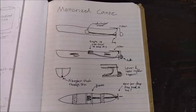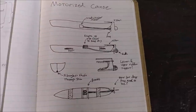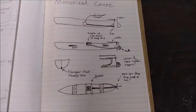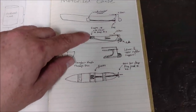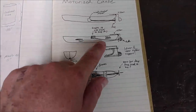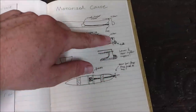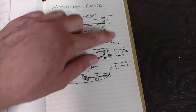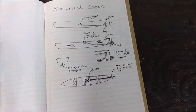My basic idea is to just lay it down in the bottom of the canoe, kind of like a regular old boat engine. So I'm going to have the motor up here — actually a little higher, just so it stays out of the water if we get any water in the bilge of the canoe. And then I've left a little bit of a curve in the weed whacker shaft, so that the propeller comes out pretty straight here. And then we're going to have to build some kind of a rudder and tiller system later on.